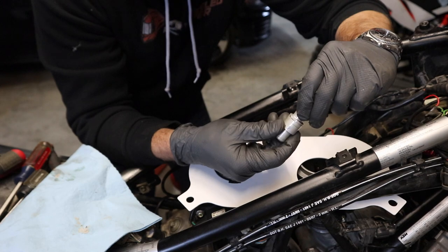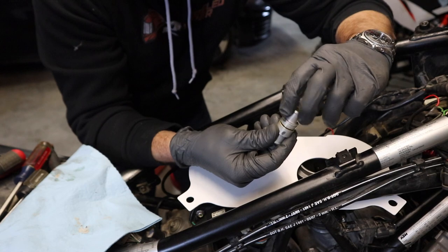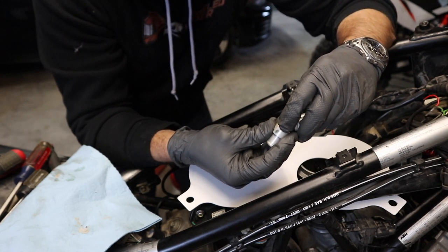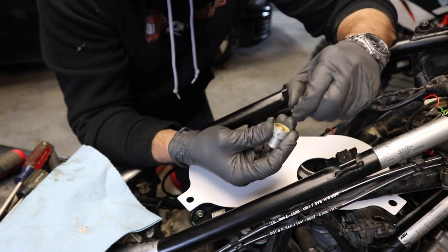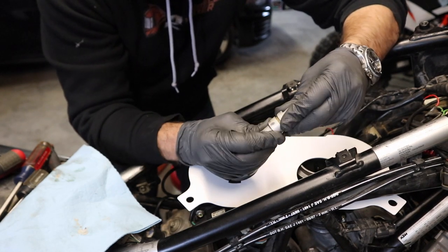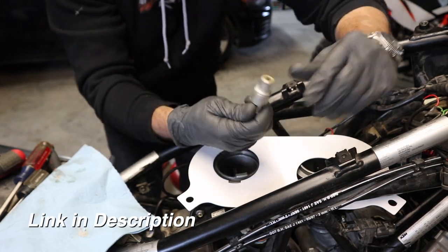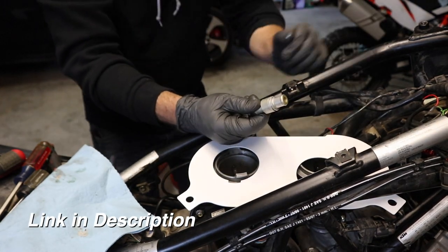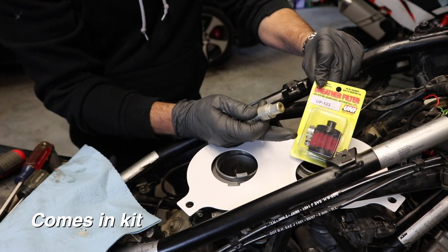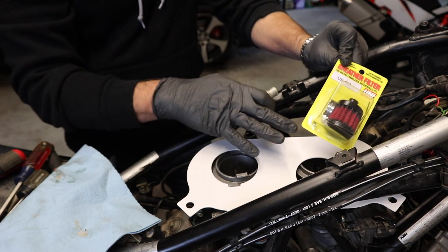With the check valve removed, if you're using the Rottweiler intake you'll take this apart — this side goes inside the airbox. There's going to be a little ball and spring in here, then you put it back together in between. Now, I'm not using the actual Rottweiler airbox — I'm using an ITG airbox. It's pretty much the same thing except it's not pre-cut, so instead we're going to use just a little breather filter on the crankcase. We'll find a way to get that out of the way and then get our base plate on and get the airbox all set up.